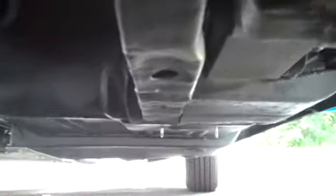Same with the back section — same on this section here. Last 20 centimetres doesn't look like it's penetrated, but there are spot welds the whole way along. Now we're looking at the diff. Going back up to the rail — same rail, spot welds all the way along, but there's a little tab that's been cut out just in the middle of the screen. This section here looks good — this little repair job just there. The rest of the car seems okay. Torque boxes on both sides are good. Rear rail is a bit banged up there from being jacked up. And the shackles on these springs — that's it.